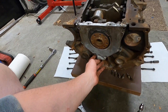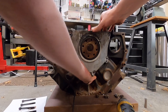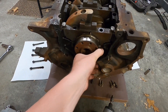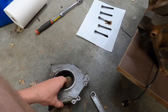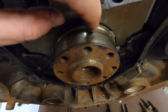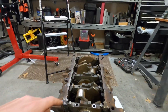We took out six 5/16ths bolts there and popped this guy loose. Here's the machine surface that the rear main seal rides on — this is all super interesting because I've never taken one apart before. Here's one piece of the rear main seal, and here's the inside of the backing plate — you can see the rest of the seal in there, a little piece that's wrapped around the crank and fits inside a notch on the main cap. Let's hop over to the other side and get the oil pump off.